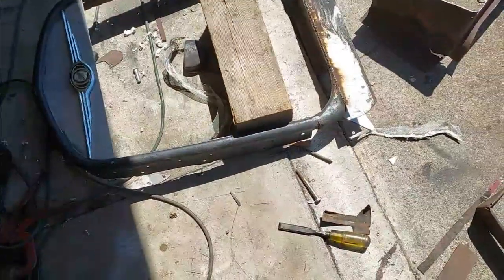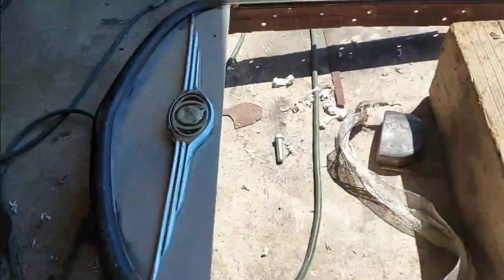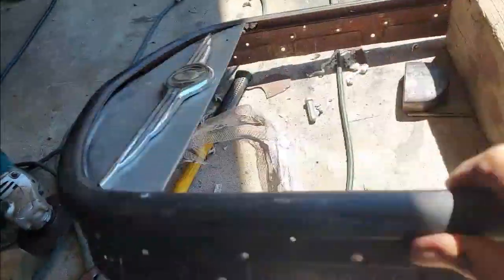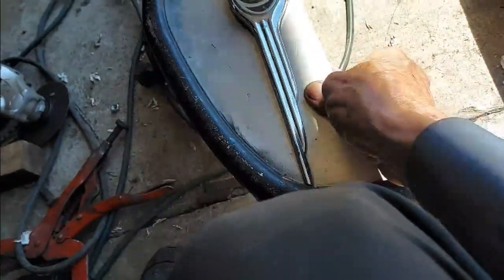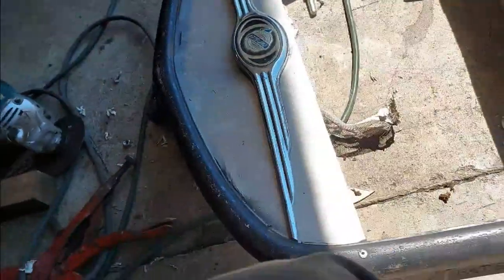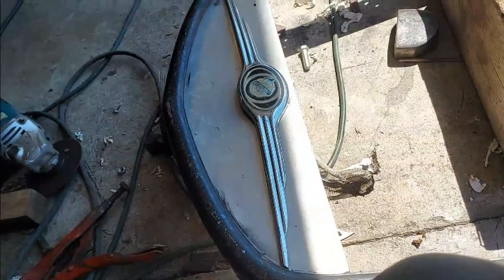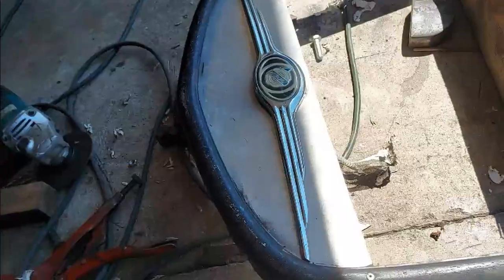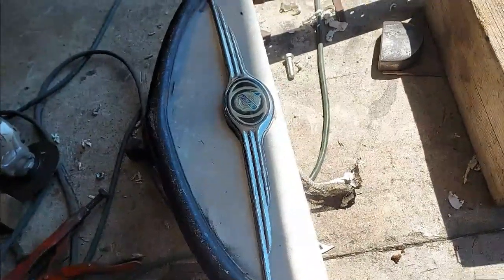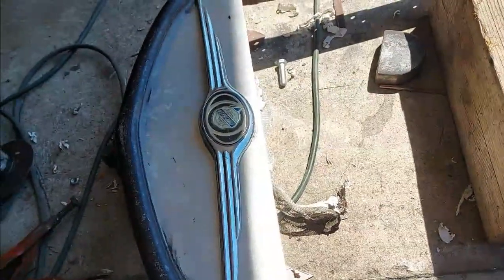I took this apart — I was gonna rust converter the inside of this. It had this old screen they used. I got it pretty much all out. The only thing holding this in is a couple little aluminum rivets. I don't know if I even want to use that. I like the logo, but I think I'd be much better off just making a good steel plate there, welding it in. I'm gonna take this out and wire brush the inside of this to spray some rust converter on it.